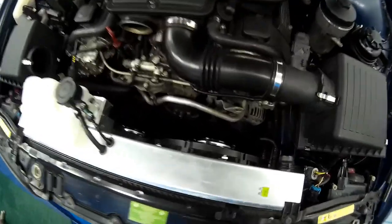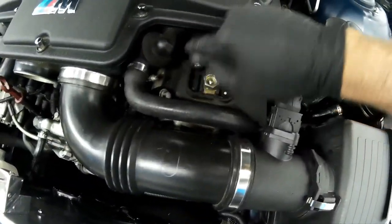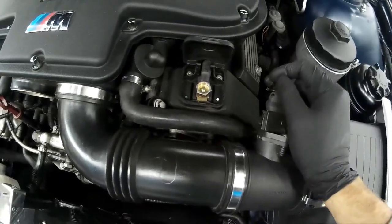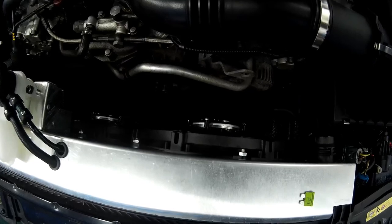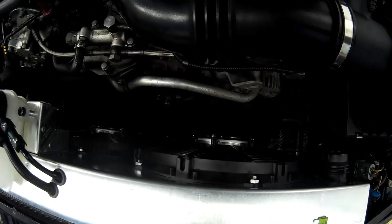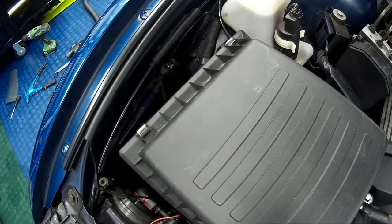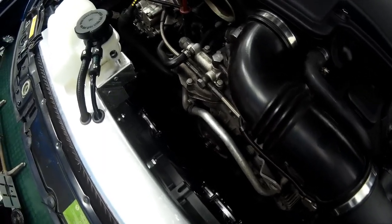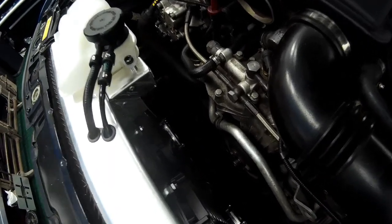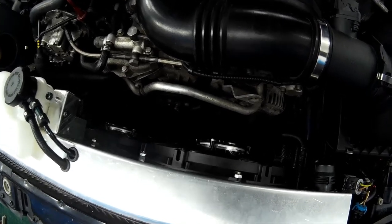Before we finalise the plumbing, we've finished the electrical system: 30-amp fuse sockets, power supply taken from under the battery booster terminal in the bonnet, the switched live comes from the ECU, and the earth goes to the earth point on the back of the headlight earthing system fixed to the inner wing. There's a manual override inside the car, and the automatic system runs through a temperature sender fitted into the bottom hose.